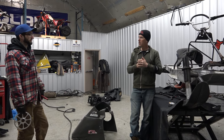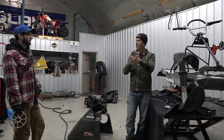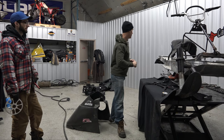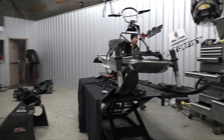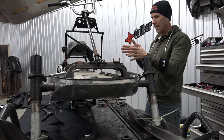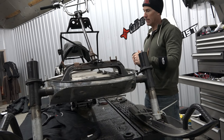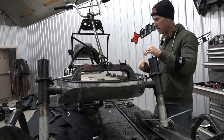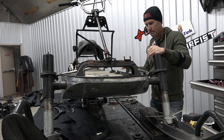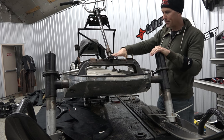I can do a 3D design of the placement. But can you do it so things are spinning to see what the gyroscopic effect would be like? I don't have that — there's a package you could buy for it, but I don't have that. Because that would be really cool. Anyway, that's kind of my thought. The more forward the engine goes, I kind of want the engine as far forward as I can get, because that gives me all my weight up front. We gotta have the weight up here. The further back it goes, I don't want it to do that too much — it looks good, but it's not very practical. I need to cut the tunnel out. It'll have to be a taller tunnel, and I'll have to place the motor down in here. But the primary still has to fit in.